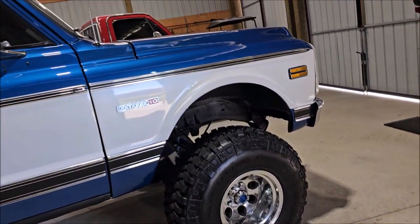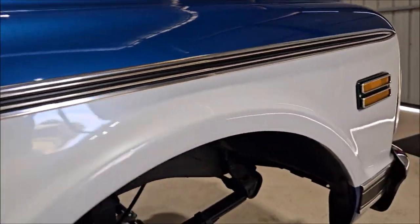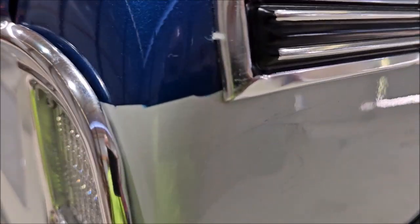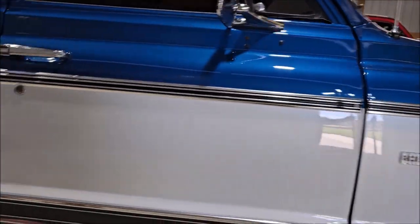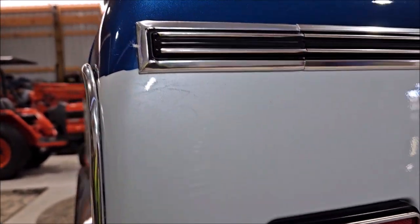This thing has lots of random weirdness going on in the paint. It's a decent job — I mean, it's not an amazing job. Notice how that line is straight, but if you walk down here that line is far from straight. That's what we got this fancy light for. You can see in there all those lines, all that random weirdness. I don't know what that is — I tried to polish it out. That's a lot of randomness. It won't polish out. I could probably sand it out, but this wasn't a sanding job.